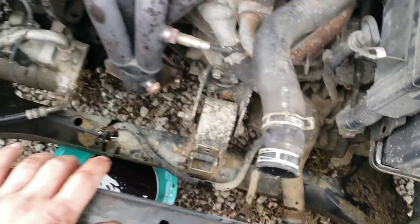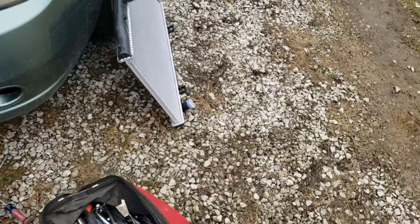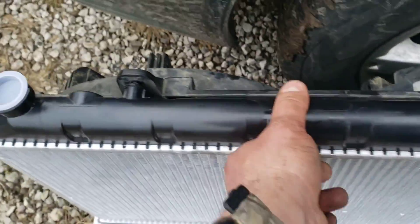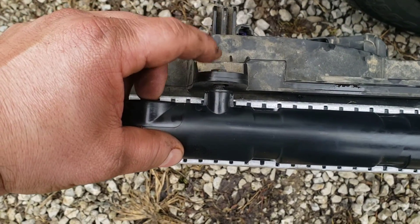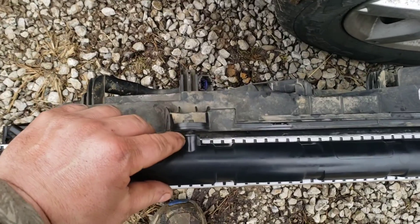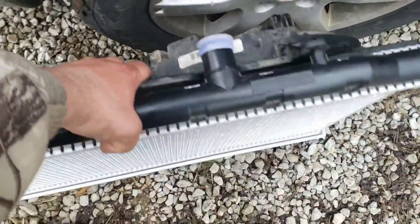That wasn't too bad. Basically installation is reverse of removal. I've already unbolted these fans here, so you just need to transfer these to your new radiator. Put everything back in the way it came out. You hook it into the bottom like that, screw it back in. I ran into a little issue — it's like the holes weren't long enough, and they just kept turning like they were stripped out. I'm going to chalk that up to a cheap eBay radiator. So if you have that happen, stop before you completely strip it out — that way there's still something holding it on there.